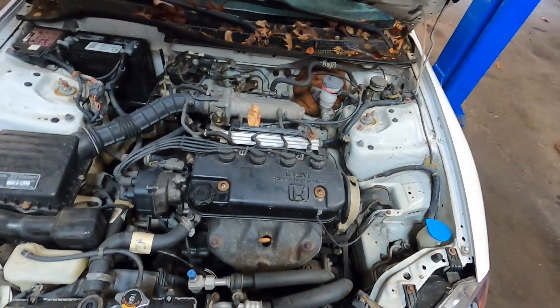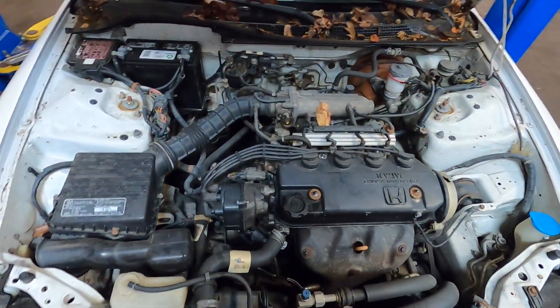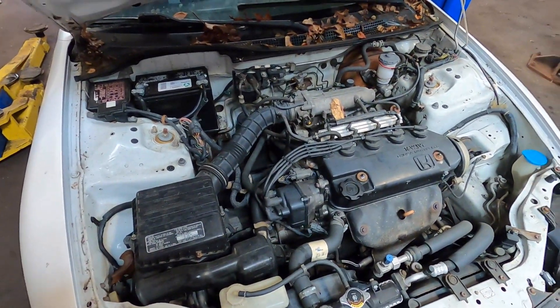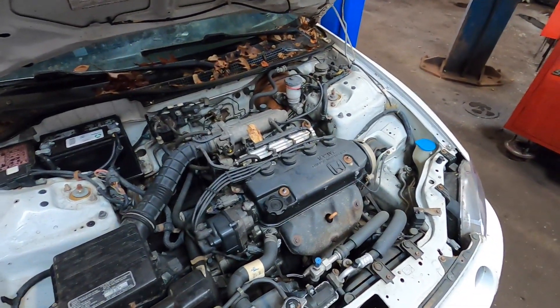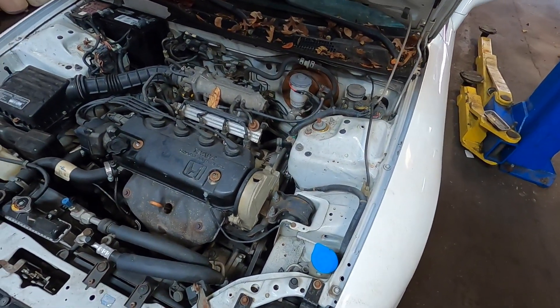A couple little fun facts about this D-Series while we're waiting: this is a single cam, non-VTEC, and it does not have power steering. This car is a '93 — probably about 93 horsepower too, roughly. It's a good engine, it's a strong engine and it runs fantastic. It actually has very similar miles to the black one. But if we can extract a little extra horsepower and put it in this one and still enjoy the engine without any rust or anything like that, that's ideal.